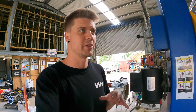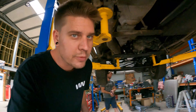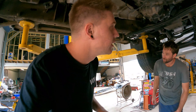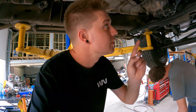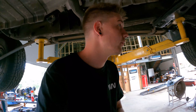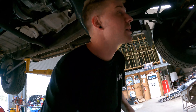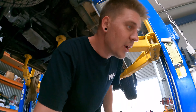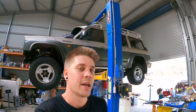We've got the exhaust back out after the dummy fit. We've refitted the tail shafts front and rear so they're ready to go again. We're going to do the trans service while we've got the exhaust out because it's much easier to get at the pan - however, we can't do the fill level properly until we get it running. At least we can dump the oil and change the filter while the exhaust is out. That'll be for the next episode though - that's probably enough for this one. Thanks for watching, hope you're enjoying the build - see you on the next one.